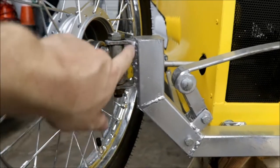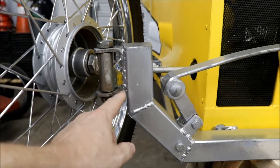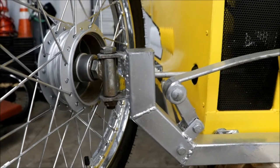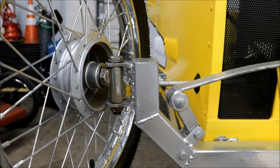All it's doing right now is just rotating right on the crown of the tire. So what we're going to do is cut off this bracket, cut this weld, and then lean it all back so the bottom part is at the very edge of this pipe, and also on the back. That should give us about 10 to 15 degrees of angle, which will be plenty for this, and then we'll see how it drives.